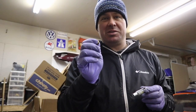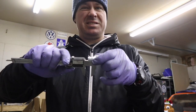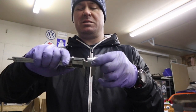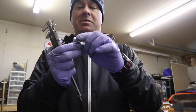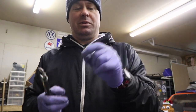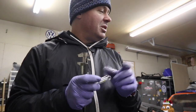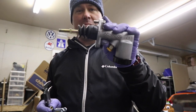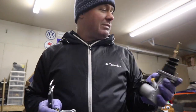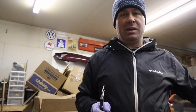So I need about 13 millimeters of room, and if I measure this piece here, I've got about 16 and a half — let's say 17 millimeters. So I've got 17 mil, and if I need 13, I could grind this all the way down, put this nut on here, and that should give me about 12 — so it'll get me really close. The absolute worst case scenario is that I have to shim the master between the master and the bracket, which I'm completely fine with. I've got all kinds of metal around here — I can cut a little piece to space the clutch master out, and then we'll be good.